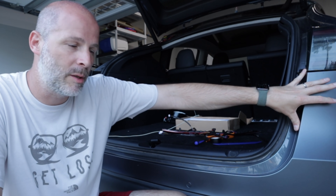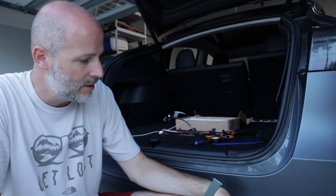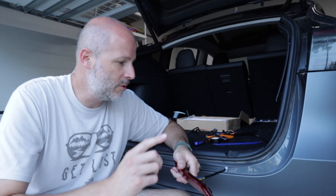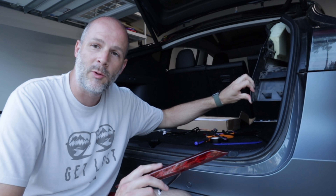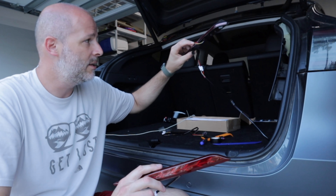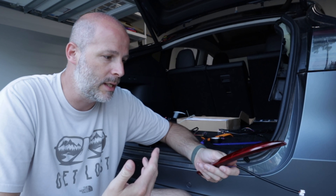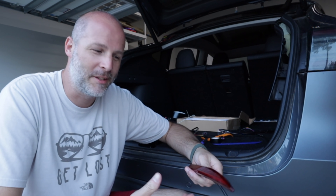There's a vent inside the bumper area, and we're going to pop it through using the wheel well — it's really, really easy. The hardest part is getting this off without damaging anything. Before you go too far into this, before you start popping these off, test these. Just pull the plastic away from here and plug in one of the lights like I showed you at the very beginning of the video, and test them to make sure they work. That way you don't go too far and then something doesn't work.